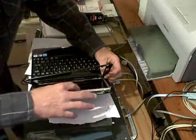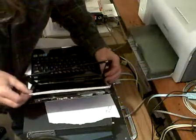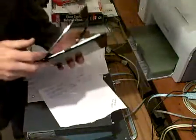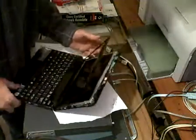The glue is here and here — about that spot on the front, back, and front there. The screen is pretty much unfastened from the plastic. You can see you've got a screw here, screw here, screw here, screw down here, and a screw in this area to be removed to change out the screen. So I'm going to do that now.